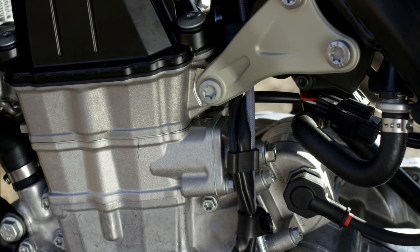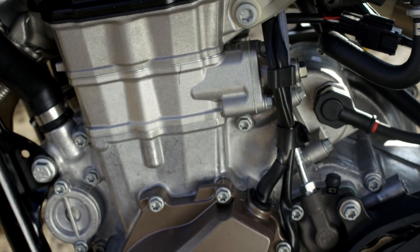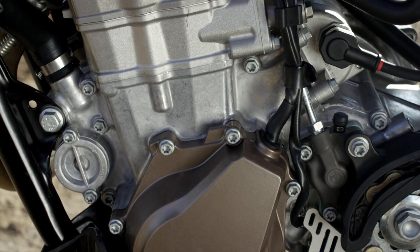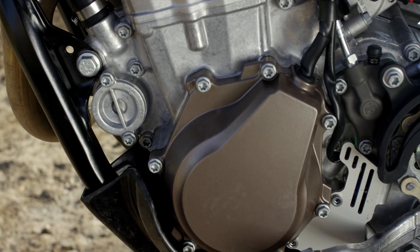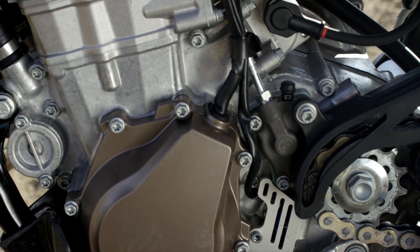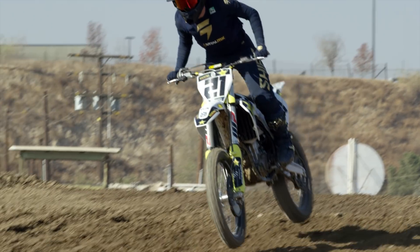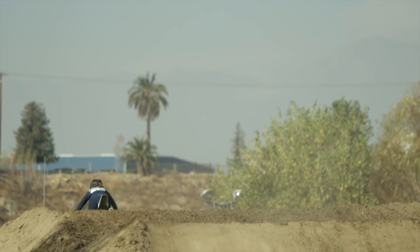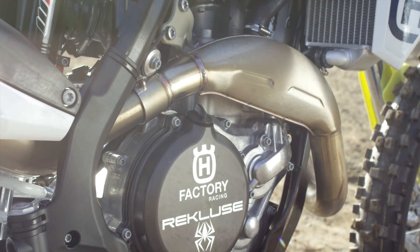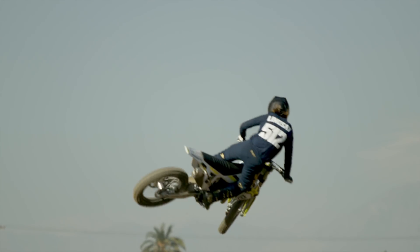The actual intake port angle is exactly the same. They've been able to change the exhaust port a little bit though — the head pipe's different, the intake lobe on the cam is a slight bit different, and the mapping. The reason being is they're trying to get the bike to be a little bit more lively. We've commented before that the Husky revs slower than the KTMs because of the air box, and even though they have a new air box this year, they really didn't improve the flow. They tried to get the bike to snap to life and come on quicker through all these other changes. The actual response from the crack of the throttle really doesn't feel any different — the Husky is still extremely smooth — but it does come on quicker. The new bike gets through the rev range quicker, gets up into the mid and top where it makes a lot of power, and just gets you to that next gear a little bit quicker.